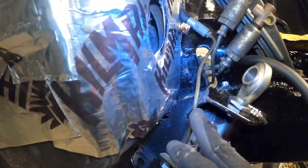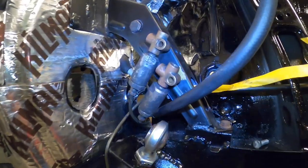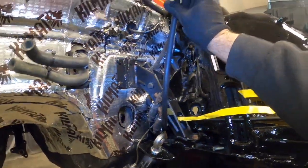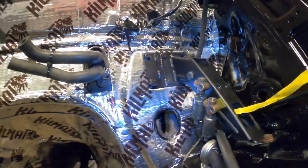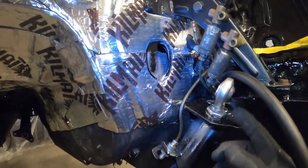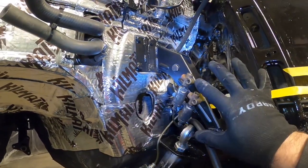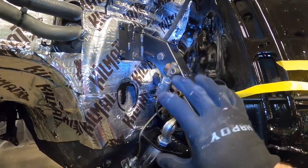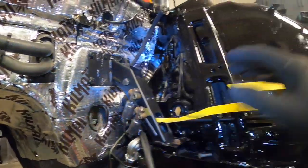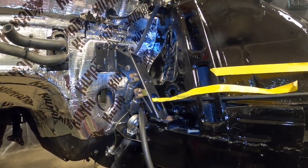The clutch line seems to be unaffected. The fuel line has now been routed, as you can see. There's no interference on the fuel line. It's gonna go straight into the engine. Remember, this is a deadhead system, so there is gonna be no return. And the steering column will end up going snaked up through here and into the steering column without any interference or obstruction. So it seems like this is going to be a bit of a complicated looking area, but I'm going to try making it as easy and serviceable as possible. And you'll see that there's going to be nice new brake lines that are going to be routed all the way through. It's going to look pretty slick when it's done.